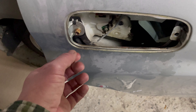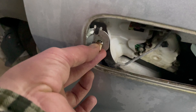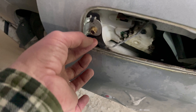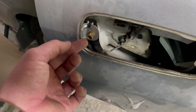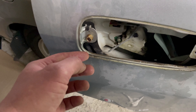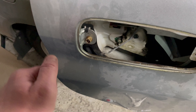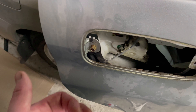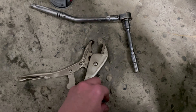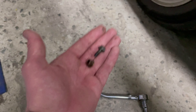To remove it, you keep spinning the bolt from the inside while pulling out on the handle, and the brass fitting will start to pull out. What I've been doing is attaching vice grips to the little lip on the innermost side of the brass fitting, tightening it back up, spraying penetrating fluid - let them soak a couple days - then just working the threads back and forth until they pop out. All three I've done so far were seized in place.